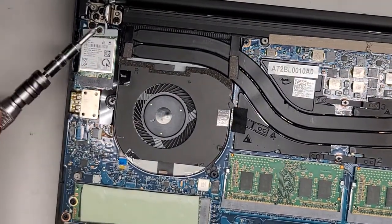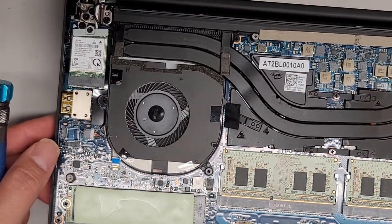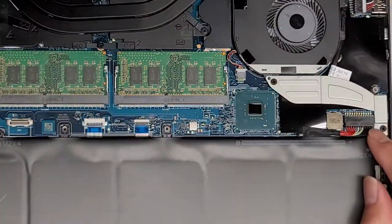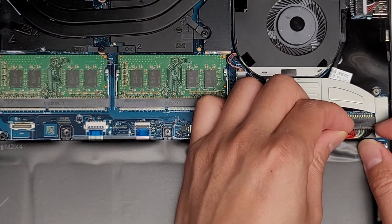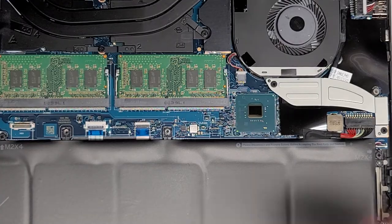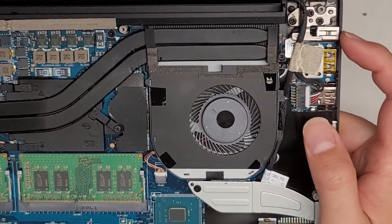You've got the wireless card here — there's one screw holding this bracket, and then you can pull the antennas up by the tails. I'm pretty sure I have another video showing the complete disassembly, but this one I'm just showing a quick look inside. There's the battery connector here — the connector I remove by just grabbing the wings or the extended part and wiggling it out. You also have the DC jack or charge port connector right here, so if your charge port is broken, you can replace that.